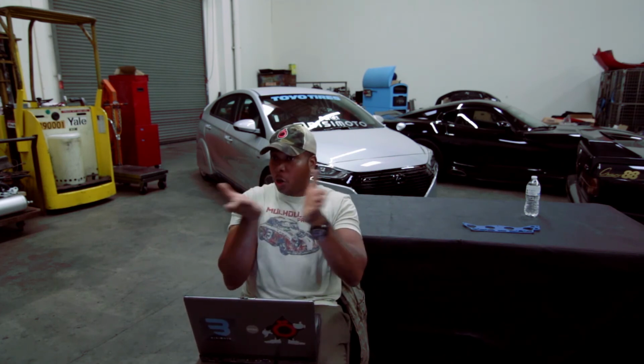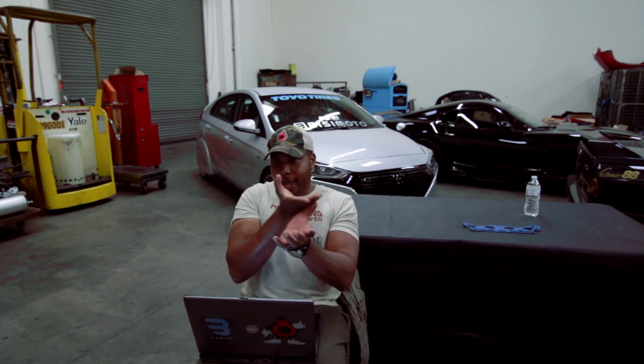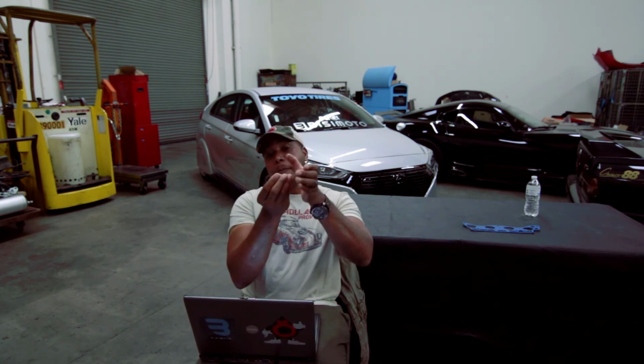Fantastic question, and I'm very excited about this question because it's right up the alley of what I've explored. Years ago, in the 90s, when Porsche really had the 993, 964 as the epitome of the 911 engine design, their combustion chambers, as they noticed, were fairly large. And a single spark from the earlier years, because it's hemispherical in nature, it's like half a globe. So just think of a globe cut in half. That's pretty much a combustion chamber. It takes a lot of energy to be able to combust cleanly in that combustion chamber.